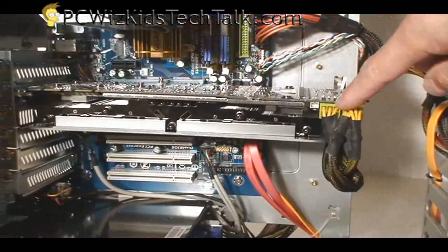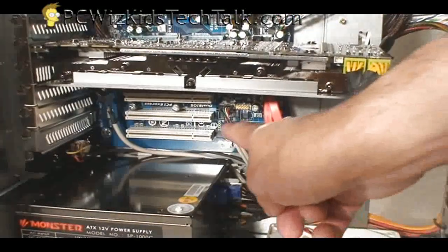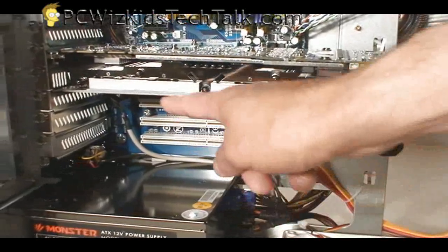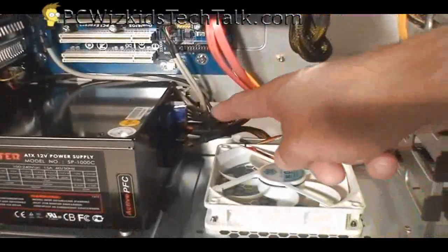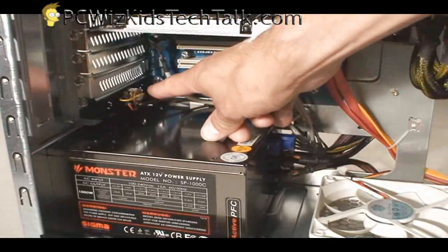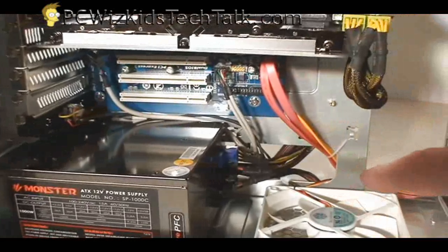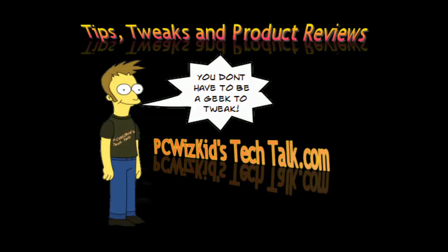As you can see, I've got minimal interference from cables as much as possible, considering the additional fan controllers I installed. I've got my USB I/O cable there, and the audio cable at the bottom attached to the motherboard. I also installed a custom fan at the bottom going out through the back. The main thing is that this power supply is modular, and that's what's really helped. Otherwise, you'd have to bundle your cables and keep them hidden at the bottom — you can't just stuff everything at the back of the motherboard tray because it just won't fit. I hope this gives you an idea on cable management to get you started. Thank you for watching.